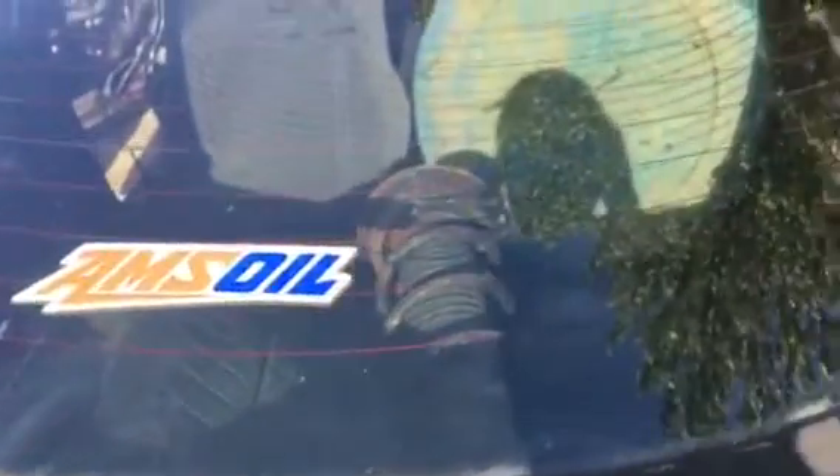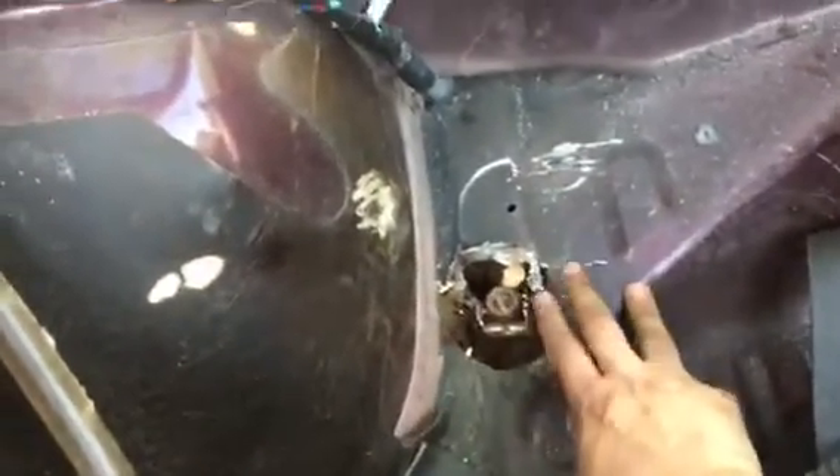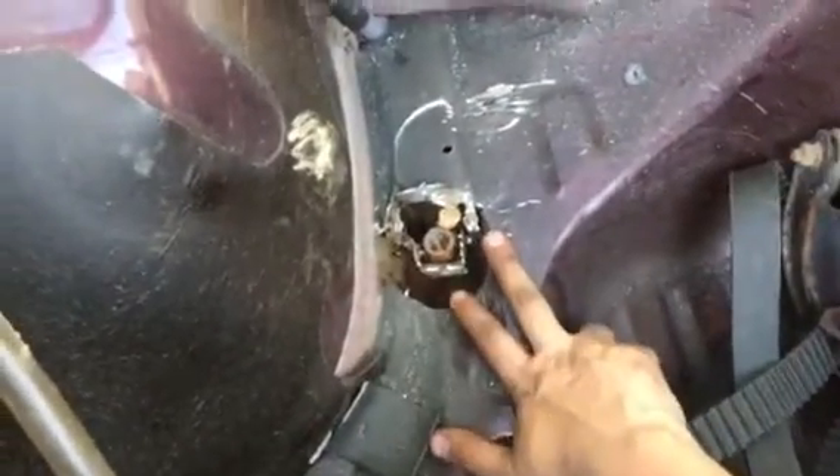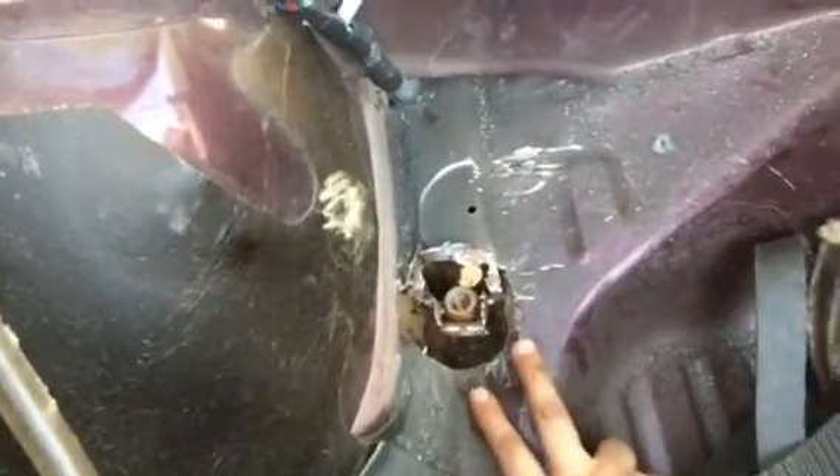The hole saw is the cleanest as far as cuts go. You can see the cutoff piece here. The problem is the area is uneven, so the saw blade wants to catch, then it wants to twist and tear up the brushes in your drill. The hole saw wants to catch and it just knocks back and forth and tears up the brushes in your drill. I've actually snapped drills in half doing that for my front mount. So I don't necessarily think that would be the easiest tool to use. Everyone always says they're just going to use a hole saw — including me when I first read about this — but the hole saw did not work. That's why no one uses a hole saw.